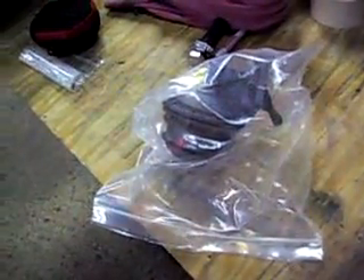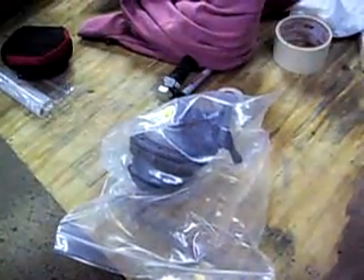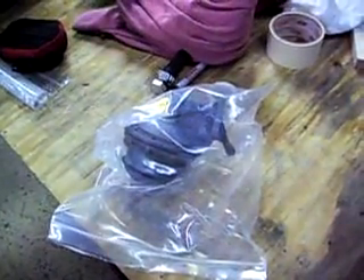I'm sending this pump home with him. This is a replacement pump for a '66 Chevelle. I found out that most pumps that have a 3/8 outlet and 3/8 inlet — like 3/8 tubing — have a 9 PSI pressure rating. Edelbrock carburetors don't like 9 pounds. So what I recommend: look for a 1969 Camaro 307 2-barrel pump — it's a 6.5 PSI pump, works perfect with an Edelbrock. If you've got a Holley, you can run the 9 PSI, but the Edelbrock is pushing it.